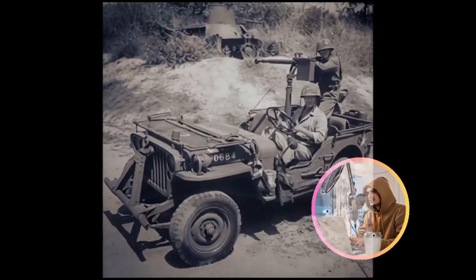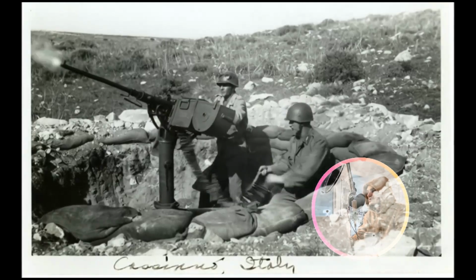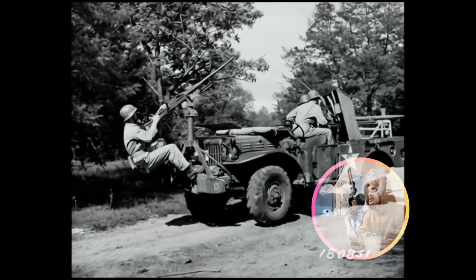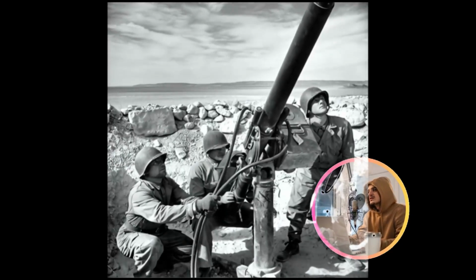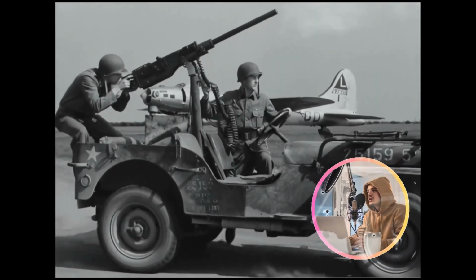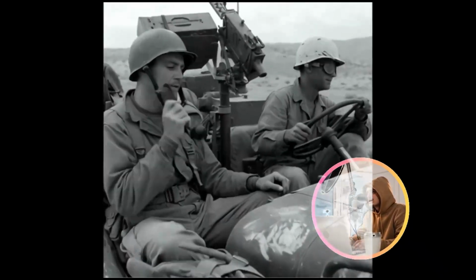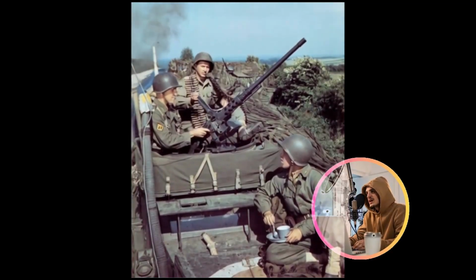The underlying physics were more akin to agricultural engineering than military science. Cupp had essentially engineered a colossal shock absorber, employing the very same principle as his tractor's spring-mounted seat, to effectively isolate the operational component from the source of vibration. Road shocks would compress the springs, which would then rebound to their neutral position, thereby converting sharp, jarring impacts into a smoother, more dampened motion. The M2's inherent recoil would still occur, but the newly spring-mounted platform would absorb a significant portion of that energy, preventing it from feeding back into the vehicle frame and creating a detrimental feedback loop.